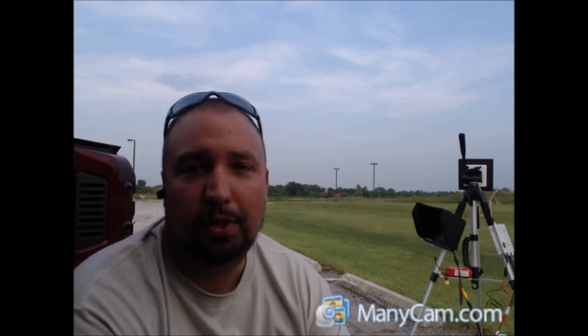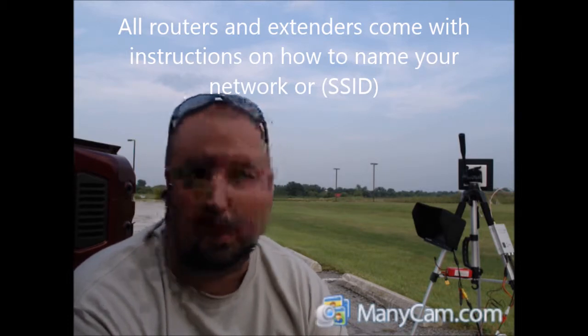With my iPhone 5 I was having trouble keeping it connected. What you do — and you can search YouTube for videos on this — is the camera's Wi-Fi network is basically 'FC40' followed by the MAC address. You name your Wi-Fi extender 'FC40-whatever' and just add a zero or one to the end, then log on with your phone to the extender and it automatically links up with the camera. It's not perfect and takes some fiddling, but the Wi-Fi extender is about $100 — maybe cheaper on eBay — and the antenna was like seven or eight dollars.